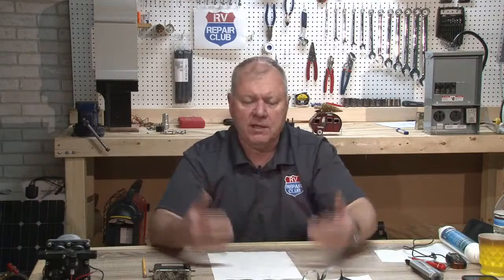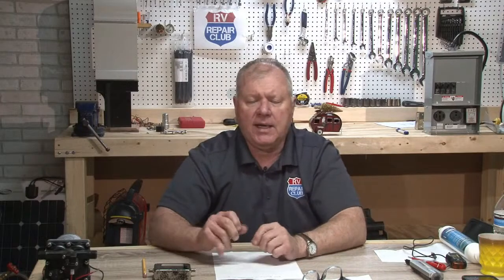The reason I say that is if you have a gas valve that opens up or leaks, you've got all these connections for your stove, your refrigerator, your water heater, and you're going down the road and it's bouncing, and you could have just a small little leak. One of the valves loosens up. You sideswipe a construction zone or a bridge or somebody, heaven forbid. But if it does, you could have propane leaking out into your RV, and then you've got your refrigerator trying to light, and that's dangerous.